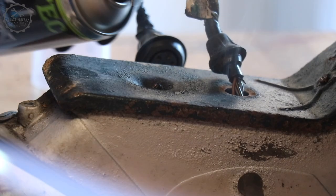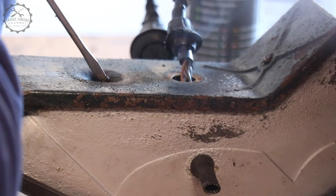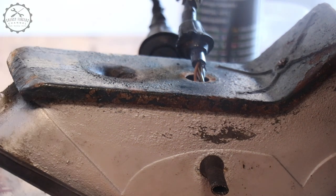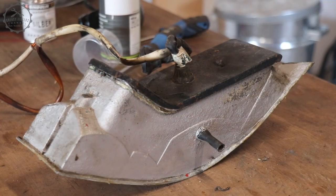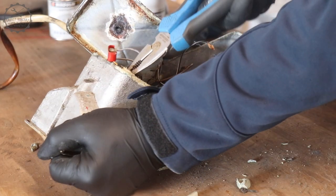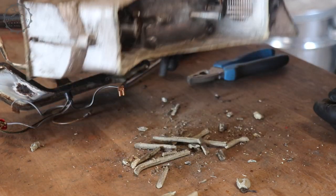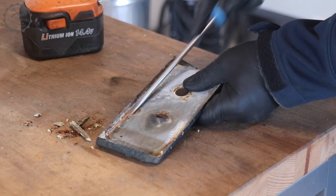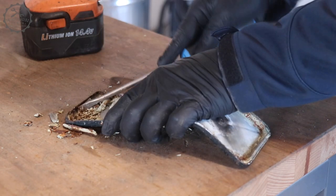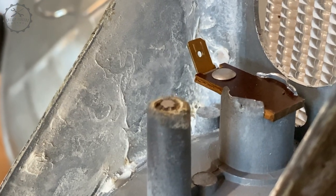You guessed it, contact corrosion has seized up the screws. I applied the usual arsenal of methods, welding a bolt on, heat and cold. It didn't work, but eventually the thermal stress at least broke off the screw head. At least I found a method to get the covers off at all.